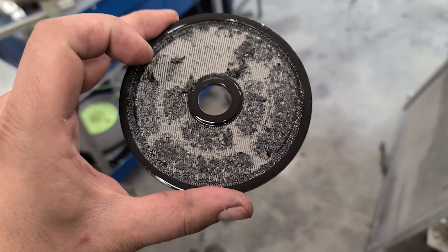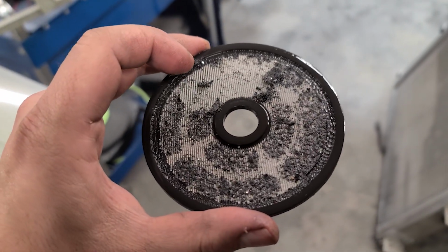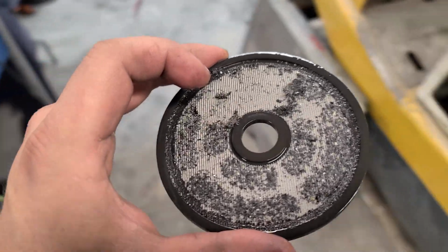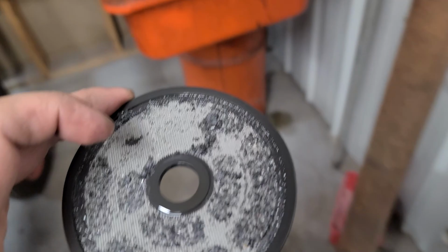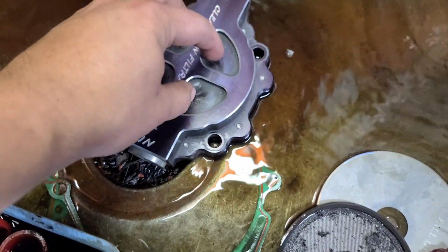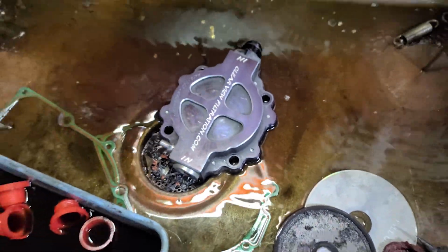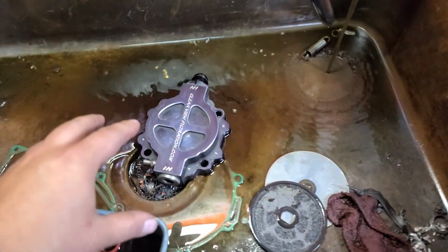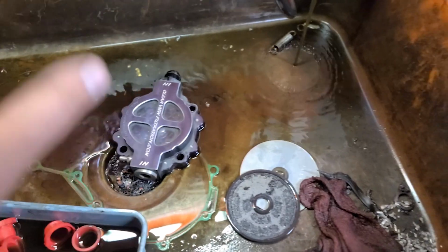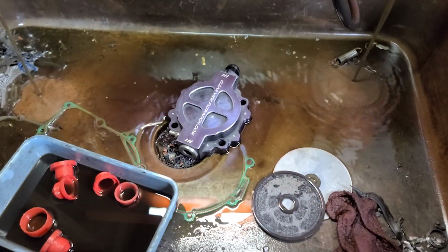A lot of people cut their oil filters open, but this thing is a true lifesaver. If you want to catch a motor soon, or before it goes, typically, you can see a lot of evidence before it does go. So I'm getting this stuff all cleaned up. Here's the top section, the top hat. Like I said, you apply air in here, blows the oil that's in there out, and then you can see through these. Obviously, sometimes you got to wipe them off. But very expensive piece. I want to say it's $400 or $500 at least. But it does help. Instead of spinning filters off all the time, cutting them open, just apply a little air, purges it out, and you're good to go.